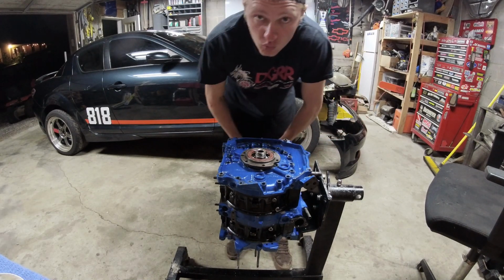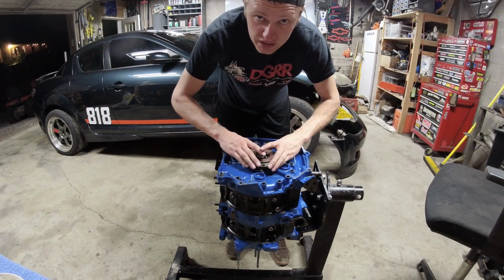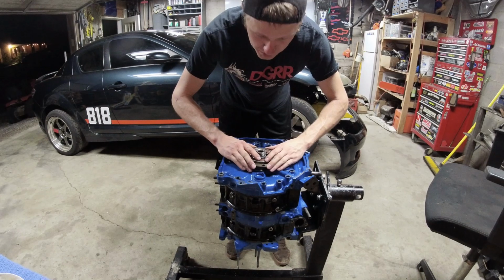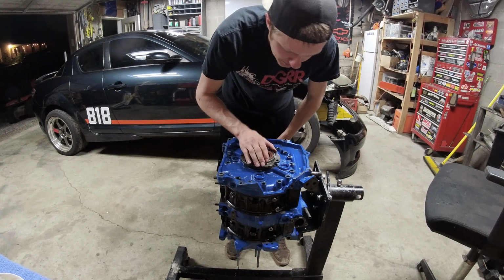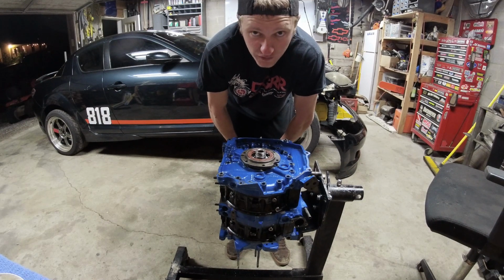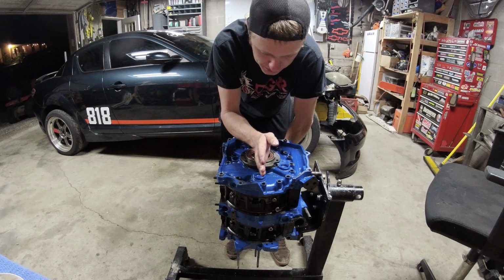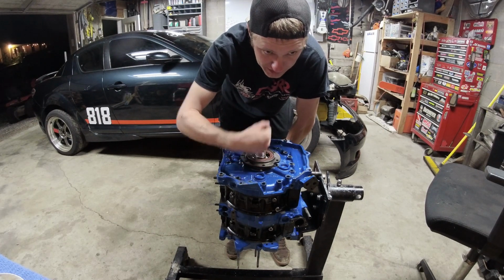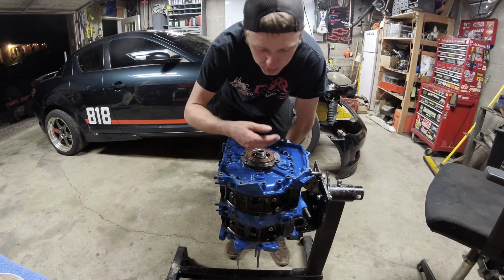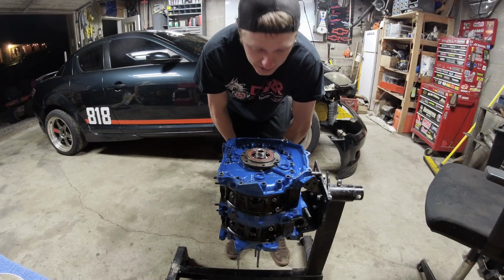Also, when you're putting the stationary gear in, you should not have to turn everything. It should just, maybe with a slight wiggle back and forth, line up. If it doesn't, that means you've got your rotors too far off of center. The front rotor, I always point up, and the back rotor, I always put down. You can do that in the opposite. You could point the front rotor down, the back rotor up, just as long as they're opposite, 180 degrees of each other.